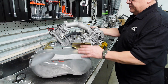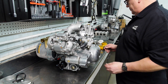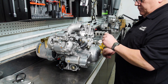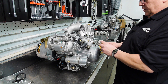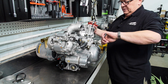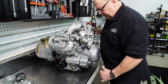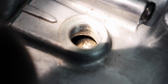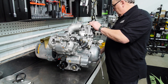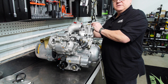Now we're going to rotate the engine using our 17mm wrench, rotating it forward on the mag side — looking at it counterclockwise while holding our cam chain. We're going to rotate it 270 degrees until we get the R mark in the inspection hole on the magneto cover. We should now be at top dead center on the rear cylinder. We can go in through the spark plug hole to verify the piston is there at top dead center.